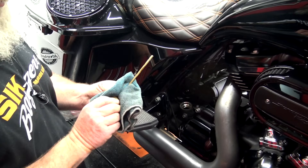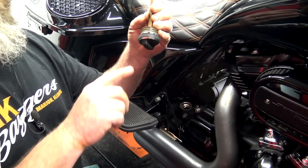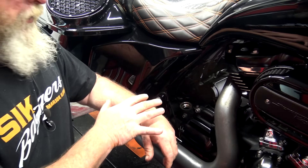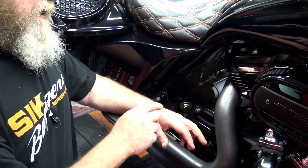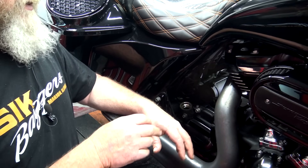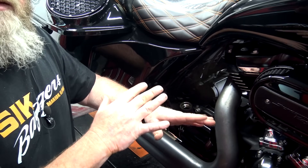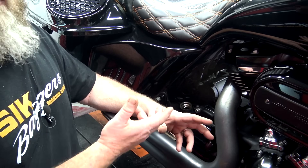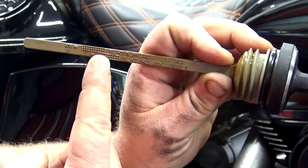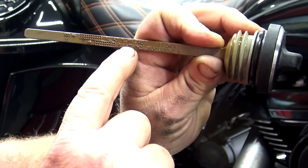Back on the oil dipstick side, take the dipstick out, wipe it down clean, and inspect the o-ring — generally it won't have damage unless it's been way over-tightened. On the Milwaukee 8 the initial oil fill calls for four and a half quarts, but given the blow-by from the breather system that sprays oil on the motor, the best thing is to run it just a little low. I tend to put in four, maybe four and a quarter quarts, then warm it up and do a warm check.